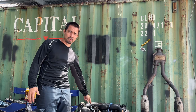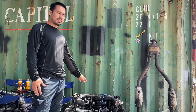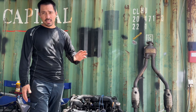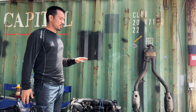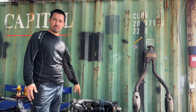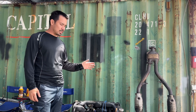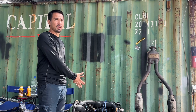The first model to come with this plastic manifold — we've seen a lot. From the early 90s all the way to 07, single AVCS typically comes with a 10 millimeter oil pump across the board. The first time we saw an upgraded oil pump was the 12 millimeter here in Japan, and that was the BL Legacy. The BL Legacy did the dual AVCS, twin scroll, drive-by-wire setup, and it came out over here in 03, 04.